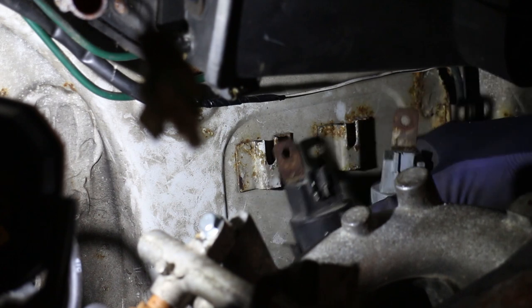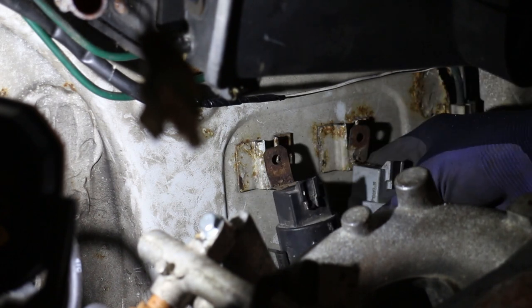The next thing to look at are these two relays. Now, one is for the cooling fan and the other controls the ignition feed to the engine loom. Originally these would have picked up on the ECU bracket, but I spotted these fixing points which are designed to take a captive bolt, which are in the perfect location. These were designed to support the fuel filter on the diesel models, and I guess Renault fitted them to every shell in the factory to simplify production.